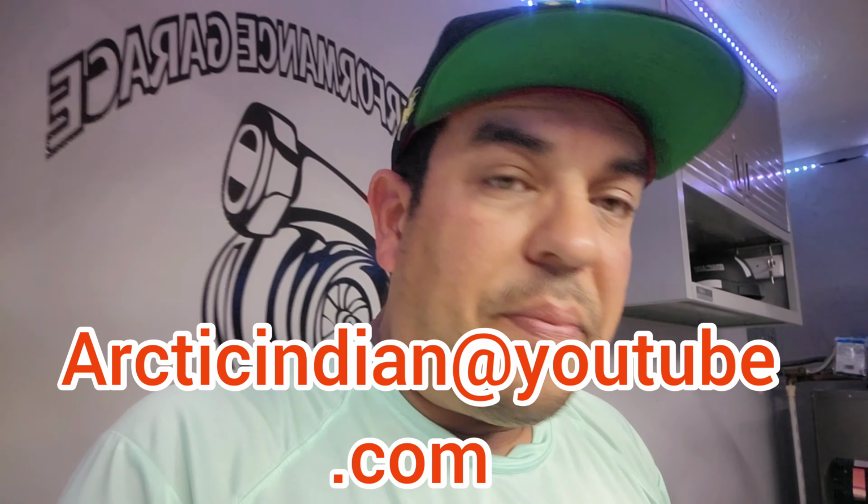Yes, guys, welcome back. Listen, we learn as we go and mess up in life. Don't be afraid to try different things to see how you'll end up. Because if I didn't try this morning to fix this fueling issue that I have, I would never have found out that I had to save my stock MAF sensor. I knew I had to adjust the timing, retarded by 10 degrees. I got that information from my cousin. Thank you very much, Mr. Arctic Indian. Whenever he gets his website and his YouTube channel set up, I want you guys to show him some love, because this guy knows a lot about the 2JZ-GE motors.